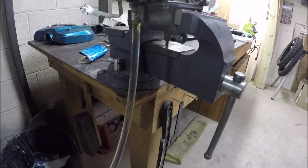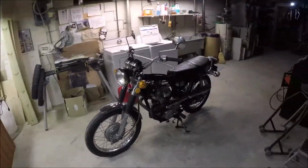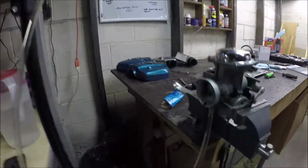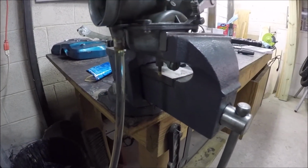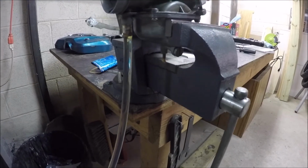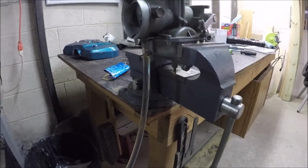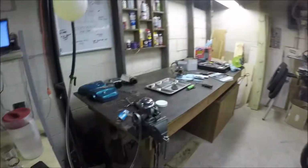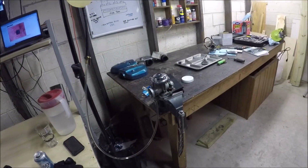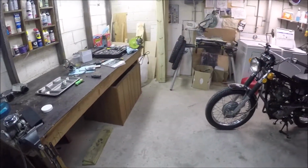I can't get it to leak, so this doesn't tell me anything, but that's a higher height than the fuel tank would be delivering, so this should be an adequate test on whether or not that amount of pressure would push the needle down too far to hold fuel. So I know that this needle can seat. Will it seat as soon as I put it on this thing? And if it does hold when I put it on, is it going to hold the week after? Who knows?